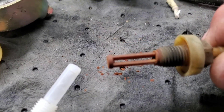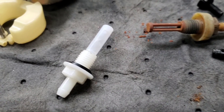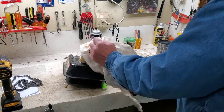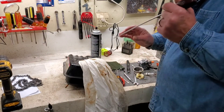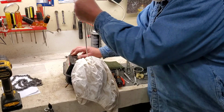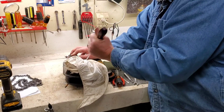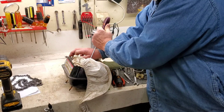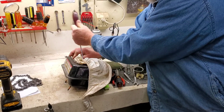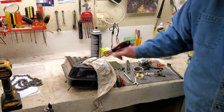This is the screen out of the tank — see all those pieces? There's no screen left, so we're just going to put a new one in. Yes, a little different, but it will work. We've got to get this customer done. Just take a little piece of shop towel, cram a screwdriver down in there, swish it around, take it back out, rinse it, and do it again. We do have a filter, so it should be okay. This is one of our commercial guys and he says he's got to have it yesterday.